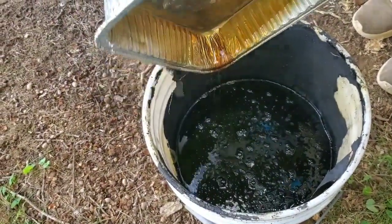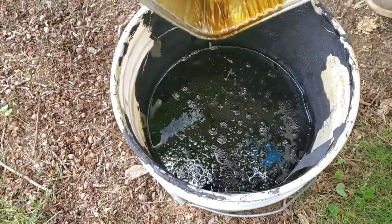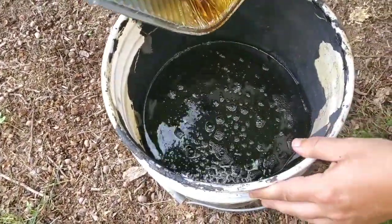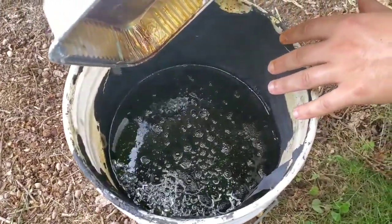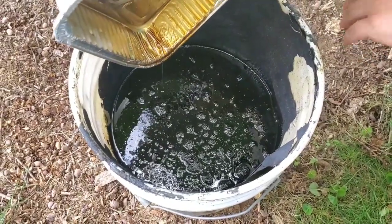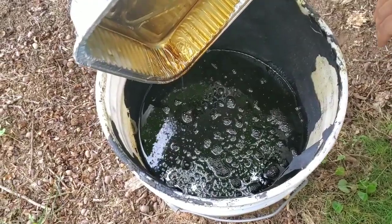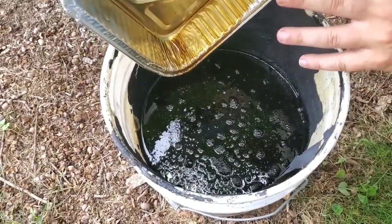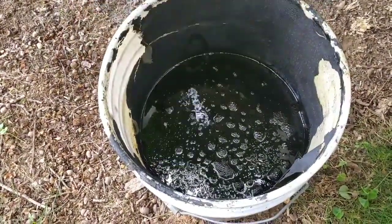And, you know, I use, we do seal coats, so I have tons of these little containers here, but it's good if you use the chainsaw a lot, because bar chain oil is so expensive. You guys know that. And I just take a little bit, little tiny bit, and I'll mix it in with the bar oil. I don't recommend it with 10W30, but with the thicker oils, works a little bit better.